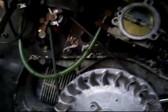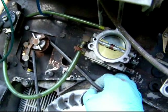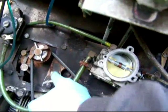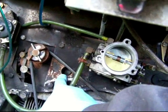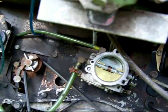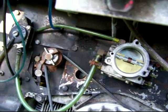All right, so I just have to get the starter belt off. That's this guy right here. He comes off pretty easily without me having to loosen up the starter. Well, I might have to loosen up this starter bolt here, and that's a half inch. This is a 9/16 in this hole here. There should be a plug here. I don't know why it's not here, but there's supposed to be a steel plug that helps keep most of the hot air on that side of the engine. See if I can find that for reassembly. Yeah, then we'll get the flywheel off and see what's going on under there.